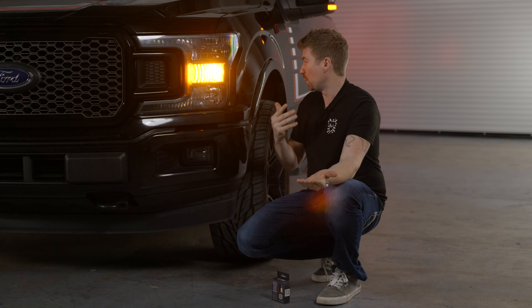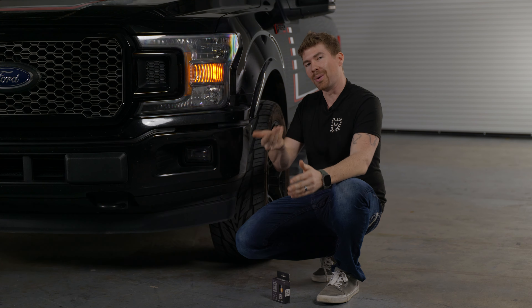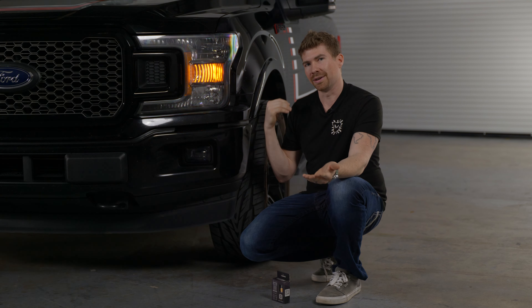What we're going to do is reach from the inner fender liner here to do the install. We're going to remove a couple bolts and then pull the liner back. We could do it from up top, but you'd have to pull an airbox and do a bunch of other work. So we're going to do it through here — follow me to this side.